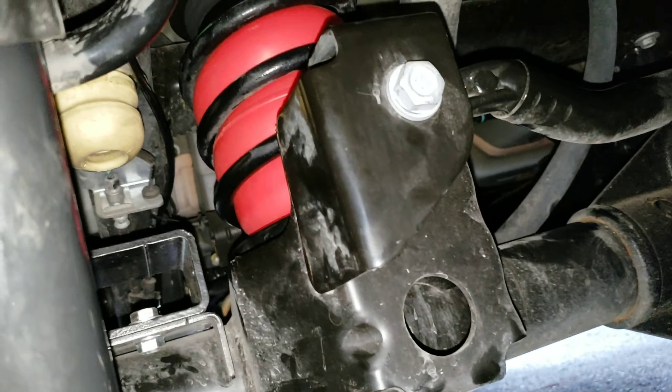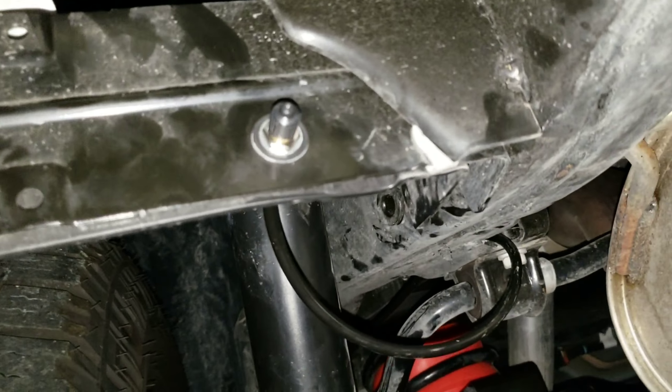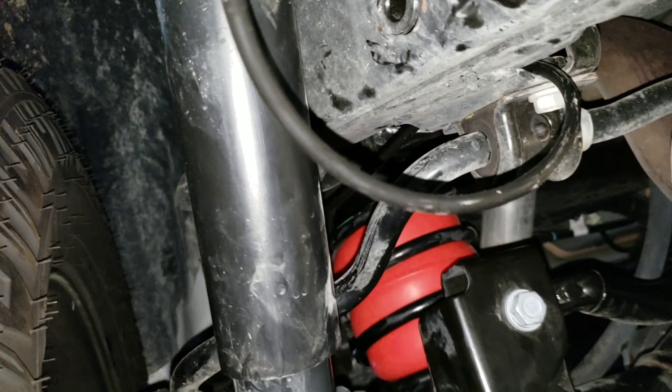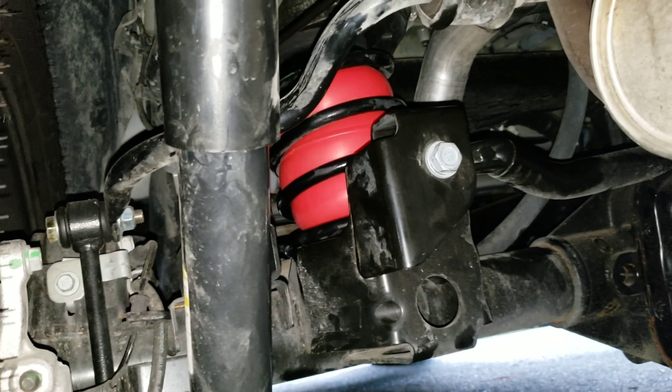As you can see, there's the airbag inflated to 35 psi. What I did is I ran the airlines up over here, in through here, and then around into this spot. The reason I wanted it here is because on the back of the bumper there's really not any spot for it — I could have mounted it underneath but that could catch a rock or anything. So right here is a very good spot; it's out of the way. Everything's zip tied up. I'll probably tuck it a little bit better. Did the same thing on the other side, but as you can hear the rain's coming in — good thing I got it finished.